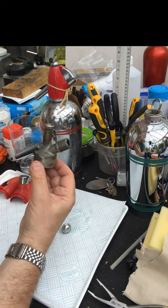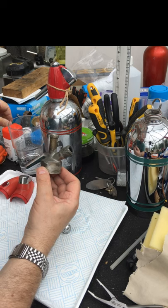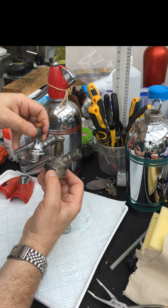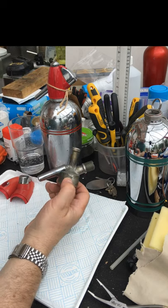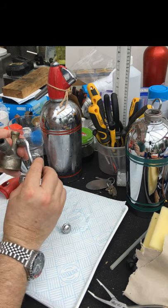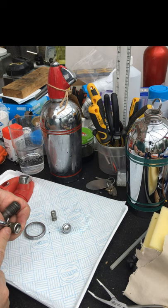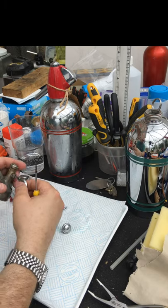That shows the head, and you can see similarities between this head from the late 40s/early 50s and the earlier Type D — you can see how they developed stylistically, with a few changes but not much. They've retained the feature whereby the control arm is riveted onto the head, and that has to be drilled out. I've done that previously and reinserted the rivet, so we can just push that out — there's the copper rivet, hollowed out so you can remove the arm.